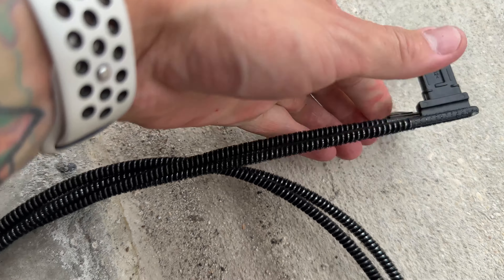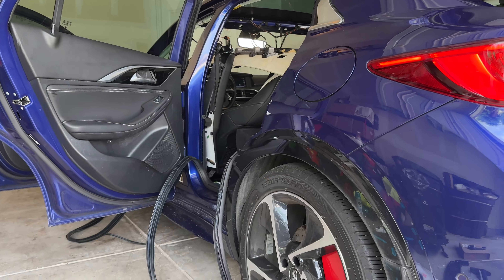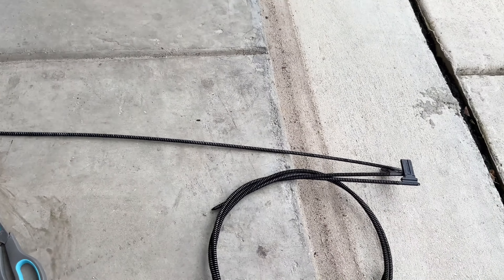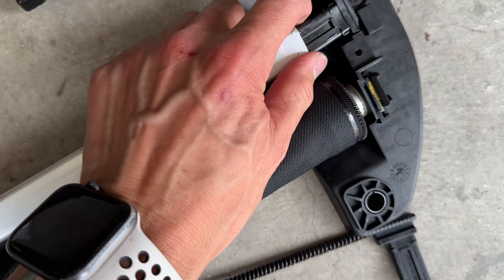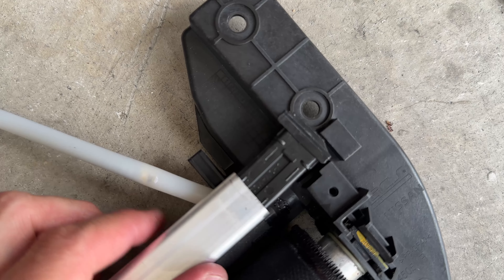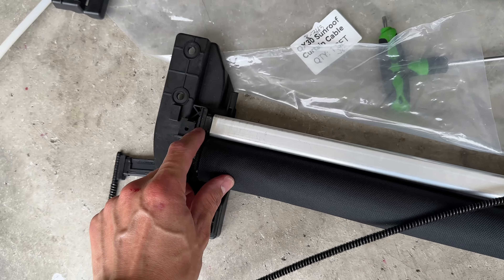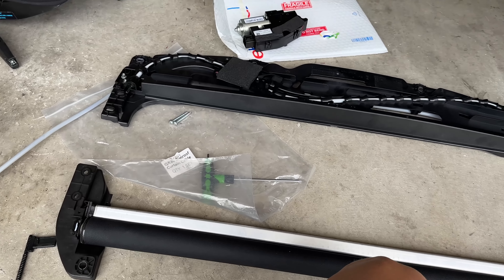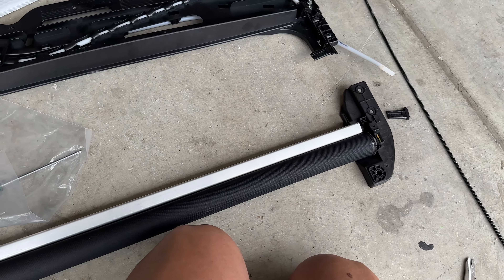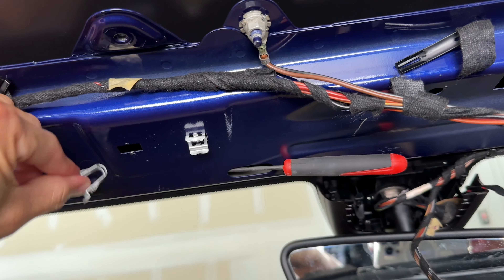Since there's no motor giving resistance now, I'll just pull it out by hand. This one is pulled out — here's the bit that broke off. It goes all the way this way to the end. We'll put the new ones in. This is so ridiculous — love Mercedes, and the QX30 is a Mercedes. So much fun, this over-engineered simplicity. Before you do that, check the orientation — pull out your old roll from the side and see the numbers pointing that way. So this one goes in that direction. Pull those broken clips out, replace the wires. I also recovered the clip I lost by pushing a pry tool through the hole.